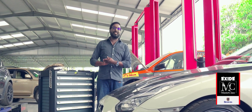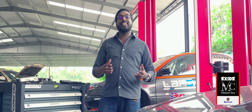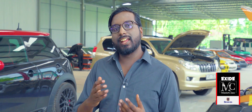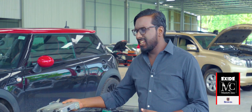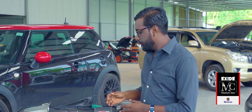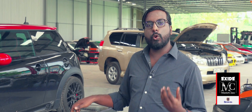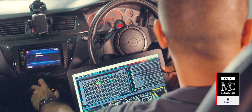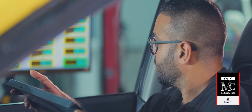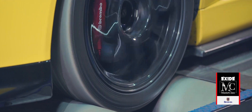That's a Stage 1 flash. Now let's move on to Stage 2. The Evo we're about to show you has an aftermarket intake, exhaust, and a few other bolt-on bits — but crucially, it has an aftermarket ECU. Why would you need to change the ECU when we could just flash the stock ECU like we did with the Mini? Your standard manufacturer ECU is kind of like a Pentium One processor — old and antiquated — and sometimes it just doesn't give you the flexibility. When you upgrade to an aftermarket ECU, it's like going for an all-singing, all-dancing Core i9. It allows you to change so many more parameters, sometimes on the fly, which saves time on the dyno and gives people like Sabri a much better balance of performance for your blend of performance parts.